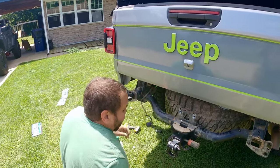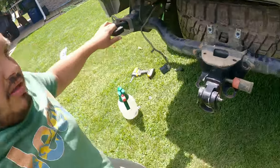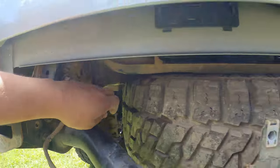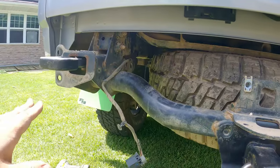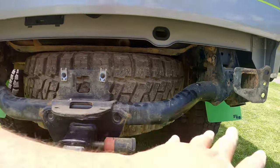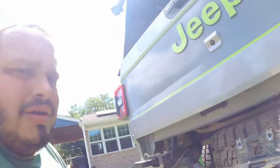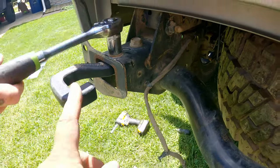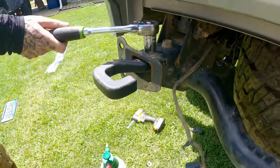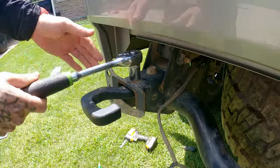We reuse these. We will have to plug in both wiring harnesses, because half of the plugs are for one harness and the other half for the other harness, even though they're all connected. I don't get it either — it's a Jeep thing. These here are 21 millimeters, and with the bumper that I've got, these don't get reused in any way, shape, or form, so both have to come out.